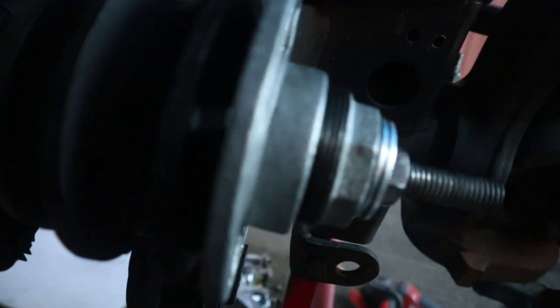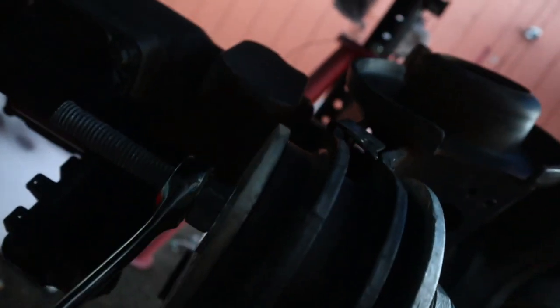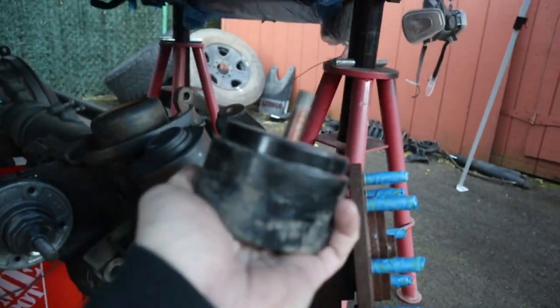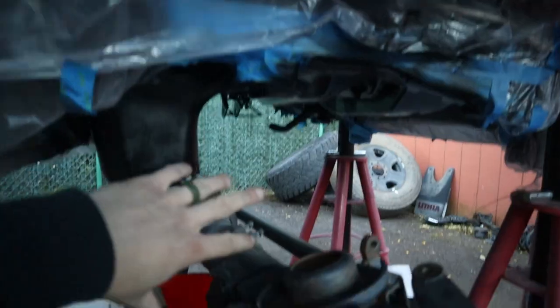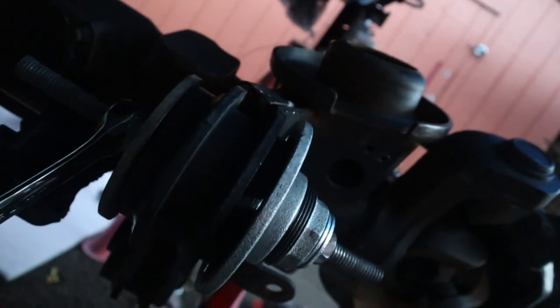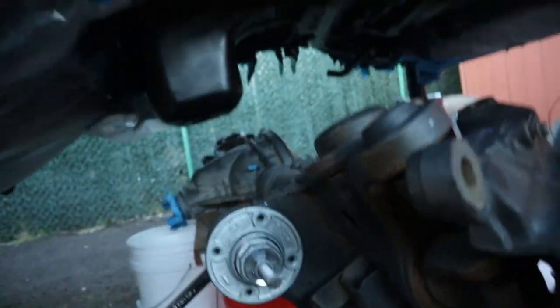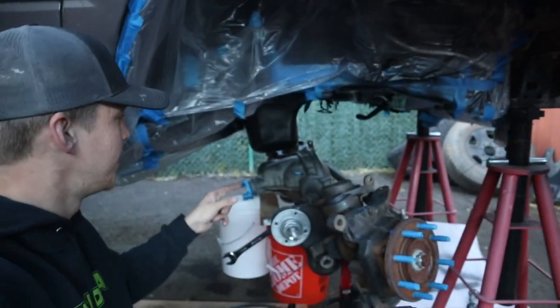This thing was a pain in the butt to get, but we finally got her all nice and seated. I actually took the old drop-down center pieces that were on the drop buckets for the springs, took that big plate off, drilled it out to 5/8s, and got it to work. Heck yeah, thank God — that was a huge sigh of relief. Now I can go through and get the rest of the axles painted.